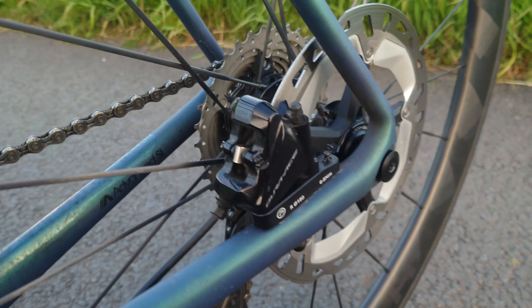I often find the rear pads and discs wear first. I think that's because they get a lot more contamination — they get all the stuff thrown up by the front wheel that the front wheel, or the center of the front wheel and the caliper at the front, misses. So they get a lot more contamination from dirt, a lot more grit.